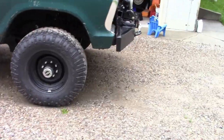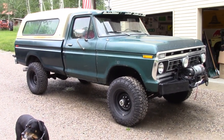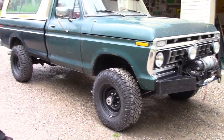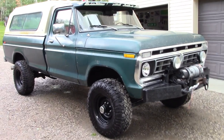Besides all that extra gear, I always check all the fluids, belts, and hoses before a trip like this — make sure everything under the truck is tight, greased, and ready to go. Went through the winch not too long ago and put a new cable on that. Repacked the bearings in the hubs and did brakes on this truck. The truck's all detailed, well at least it looks that way — we're about to go get it all muddy. I armor-all the tires and inside the wheel well to hopefully prevent some mud from sticking, because this mud is pretty sticky and hard to clean up.